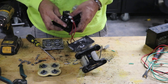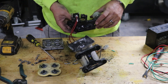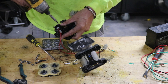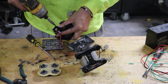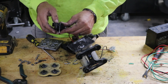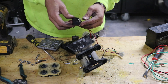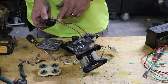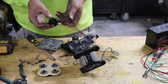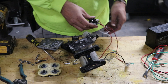This looks like another little diaphragm and I assume it can wear down. Let's pull this completely off. I'm wondering if there's a solenoid in here too. This looks like it could be a little solenoid, and if this has gone bad — right here, that's a little solenoid. We're going to test the power on this to make sure it pops like it's supposed to. See there are additional wires going up to here, because if a solenoid doesn't open up all the way or it's stuck closed, you're going to have a problem. Let's get a little power to this.